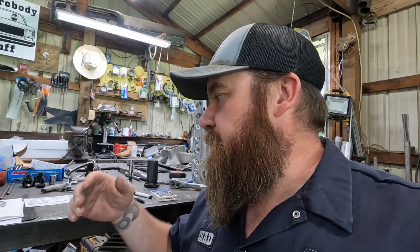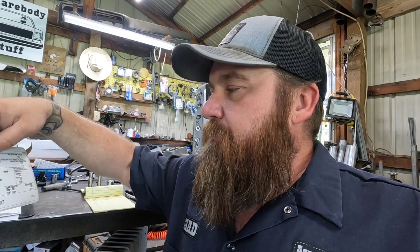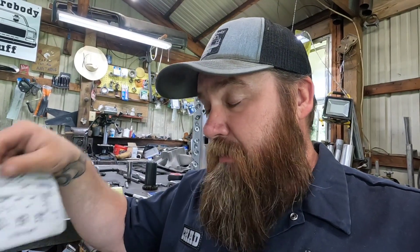So how do you find your overlap? The way I've always done it: look at your advertised duration. The advertised duration could be taken at 3 thousandths or 6 thousandths of lobe lift. The best I can come up with on this camshaft is they took the advertised duration at 3 thousandths of valve lift. On the cam card it's got 313 for the exhaust duration and 303 for the intake duration. You add those together — 616. Divide that by four — and you get 154 degrees. Then you take the lobe separation angle away from that and you get 40 degrees of overlap.